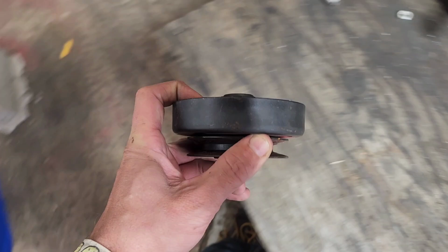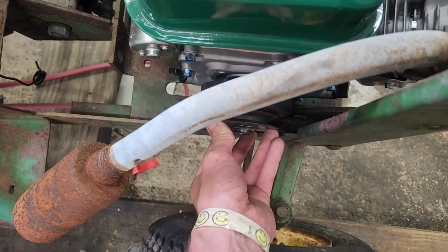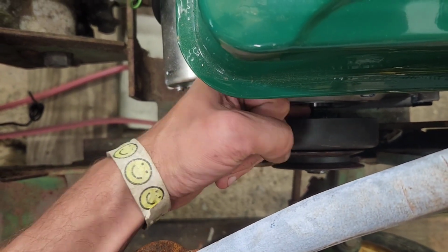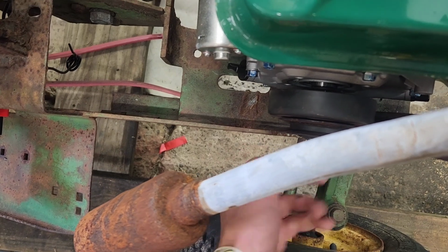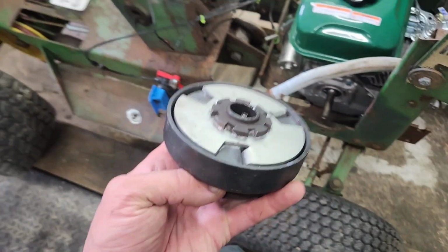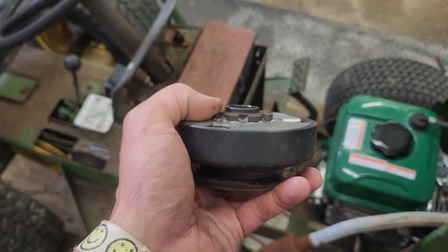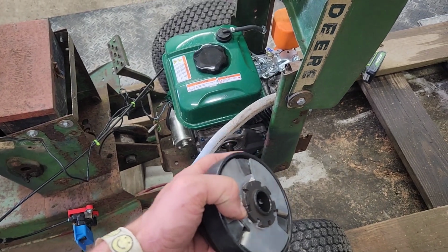But now, if we take this, and we come over here, now I'll slide this one onto here. And as you can see, that's got a kick out. And my entire pinky fits in there with extra. And the belt is attempting to go through the sidewall of the chassis. So I gotta do two things. I either gotta grind down that so that this slides on there further, or we grind that little chunk there out enough so that this slams back further. I'm more inclined to grind on the $25 part than I am to grind on the $200 engine right now.